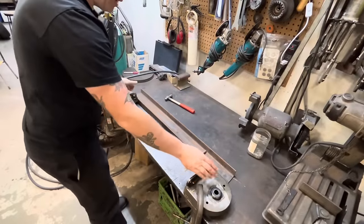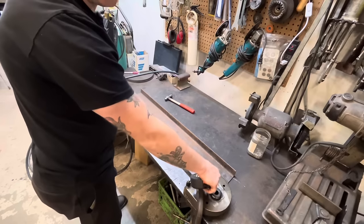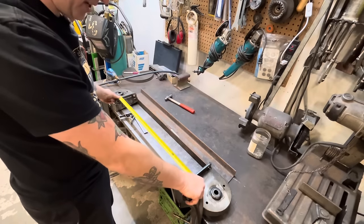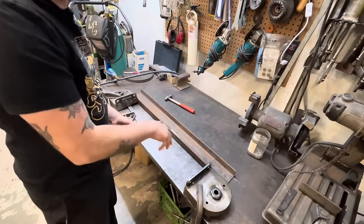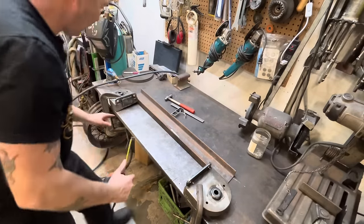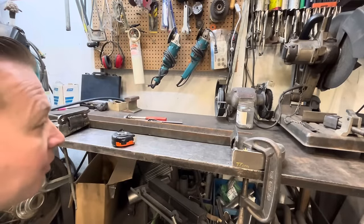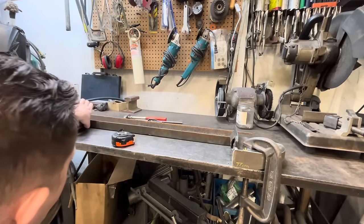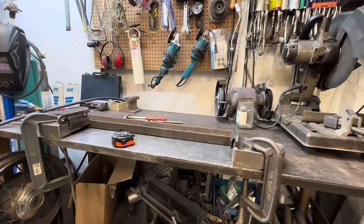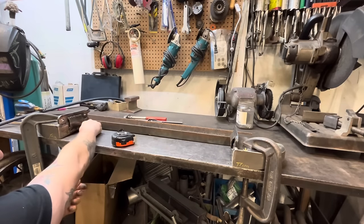We've got these two little uprights and they need to be 30 inches from this outside to this outside, 30 inches outside to outside, in order for the control arm geometry to be right. So we need to notch the sides here to fit over top of our frame essentially. They've got the anti-dive already put in, so you just mark this to be the top of your, sit on top of your frame. This is the front, and then this is the back.